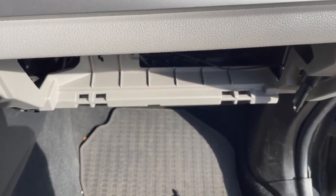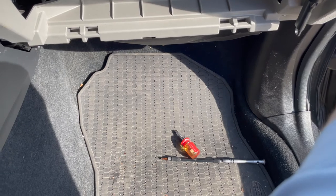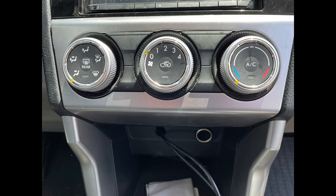If this didn't fix your problem, it could actually be the blower motor itself and not just the resistor — that's not too bad to change either, you'd just drop the piece under the dash. It could also be the control unit, which in my case ended up being an additional problem. That's a bit less trivial to take apart and there aren't many good dedicated YouTube videos. I'll link a few stereo replacement videos in the description — in order to replace the stereo you have to remove that unit anyway, so those are good sources for removing the A/C control unit. Otherwise, I hope this helped — have a good one!